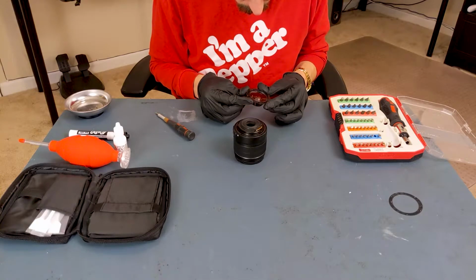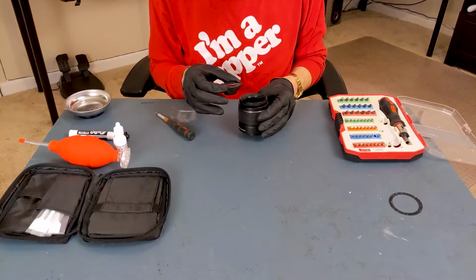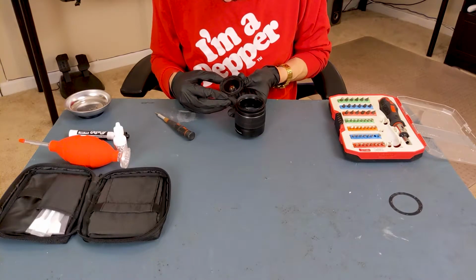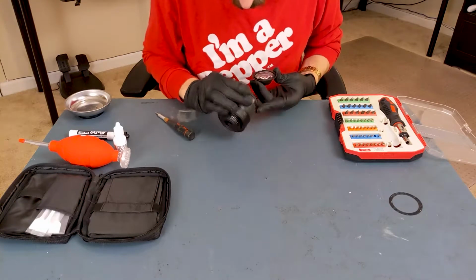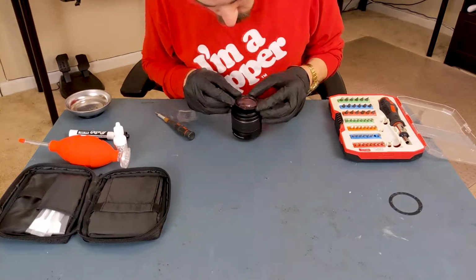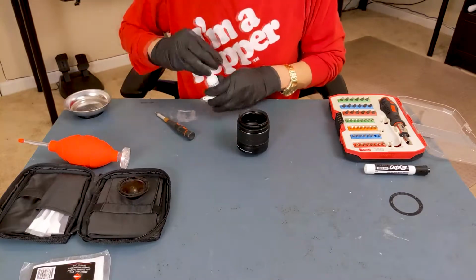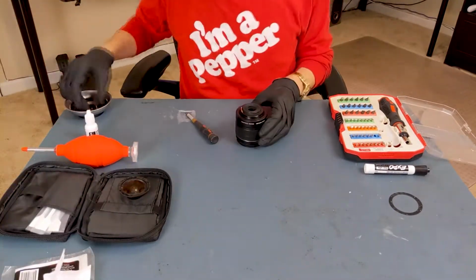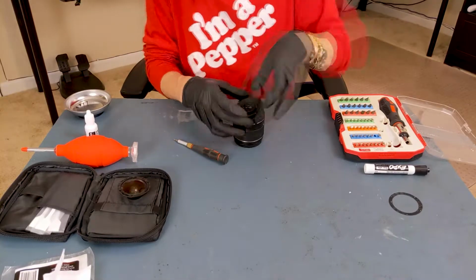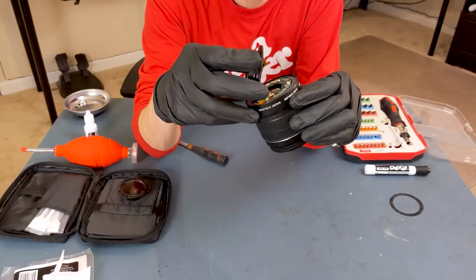Whatever you do, do not be like me. Do not wipe off your alignment marking. I was eventually able to get the lens set back correctly, but it was a giant pain. I had to look very carefully for tiny machine marks left by the screws previously. Be extra careful whenever you pull this off. In fact, don't even remove it if it's not dirty on yours.